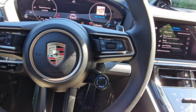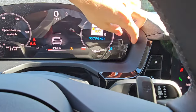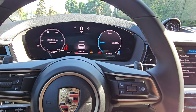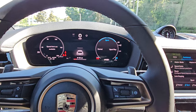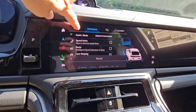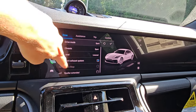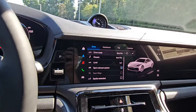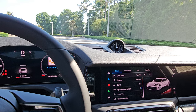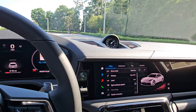Now for drive modes — this is a Porsche, so this is the most important stuff. The car always reverts to Normal on startup: everything is comfy and soft. Twist to the right for Sport — sharpens throttle response, opens the exhaust note, adjusts and stiffens suspension, lowers the car, opens sports exhaust, and disables stop/start. In Sport Plus, the car drops all the way down: chassis is super stiff, sports exhaust remains on, gears are held longer, throttle response is even sharper, the throttle body stays open between gear changes, and there's quicker response when you lift off the gas.